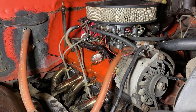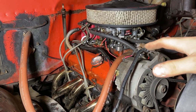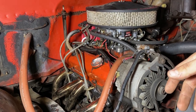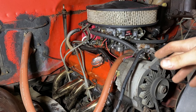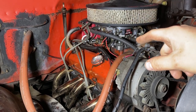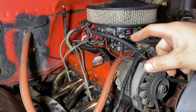I think this thing's got a bad camshaft. Why? It's hard to tell with the exhaust the way it is. Yes, it's a little loud, but I've driven things with plain old open headers. They never drive the way this thing is driving. So there's a really loud chatter on this side coming from the engine. And on this side exhaust, there's a putt. So it's idling.